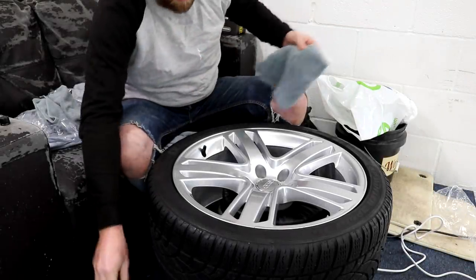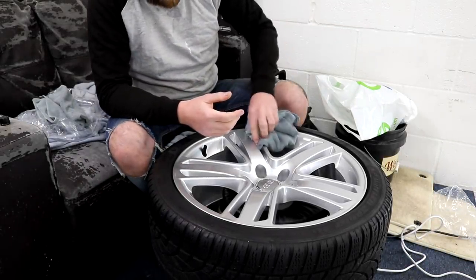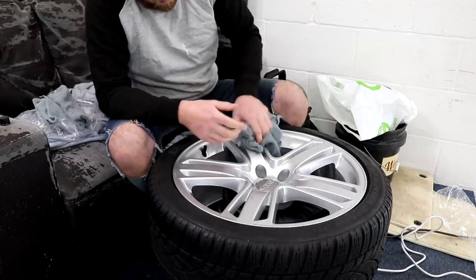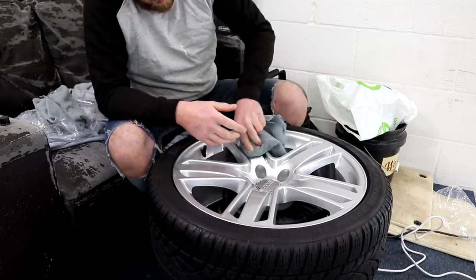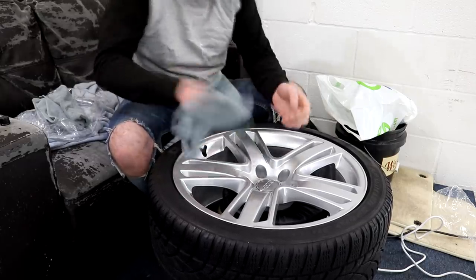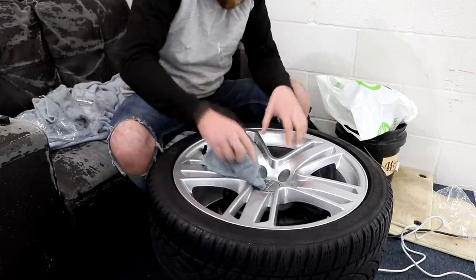The CSL black treatment requires a minimum of 3 hours before applying the next layer, and there's 3 layers in total, and with each layer taking roughly 2.5 hours to do, I did find myself with 30 minutes spare, which was perfect for ceramic coating one of the winter wheels at a time.